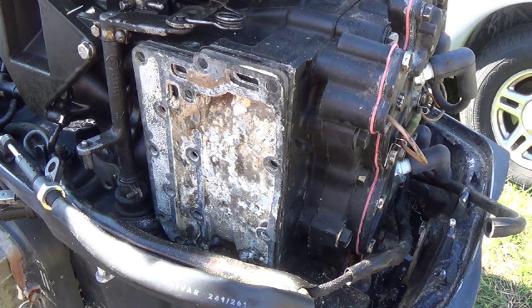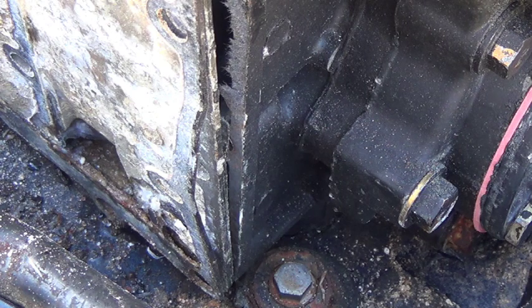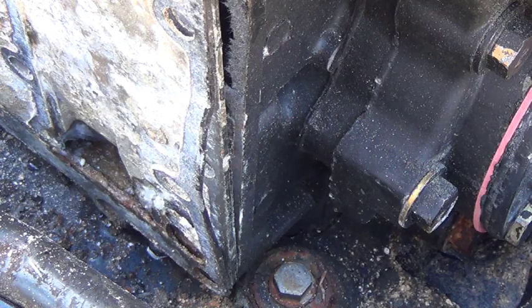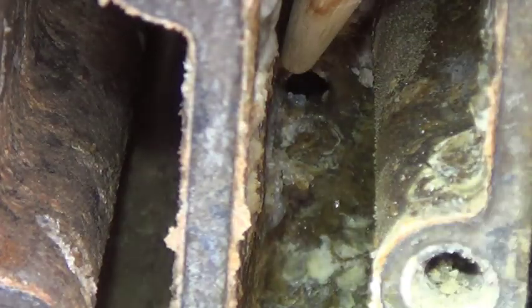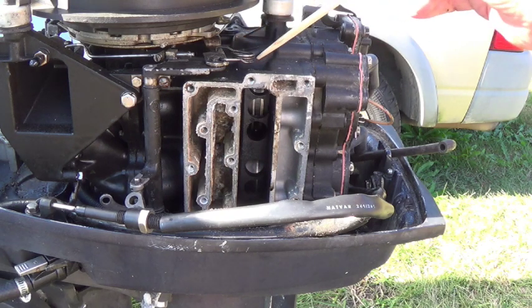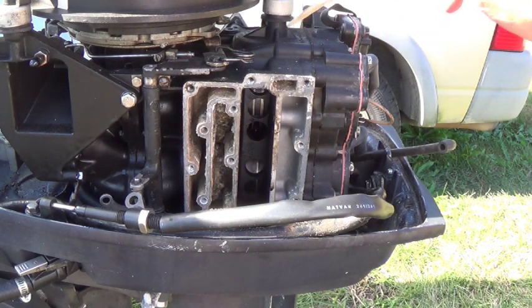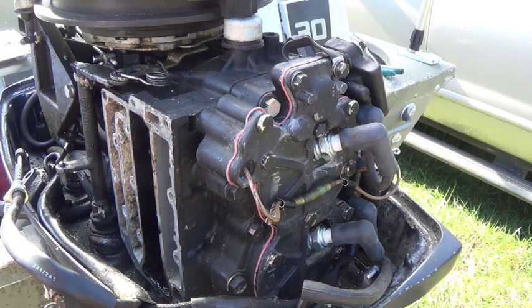To keep going with the water — you've seen where that water has gone so far. Once this cavity fills up with water, it goes right through there and goes into the engine. Another place, once this cavity fills up, you can see there's a hole right there. It fills those water jackets that are around these cylinders on the inside — you can see them when you've got the head off; they're those round circles — and it fills those water jackets up and flows around there.